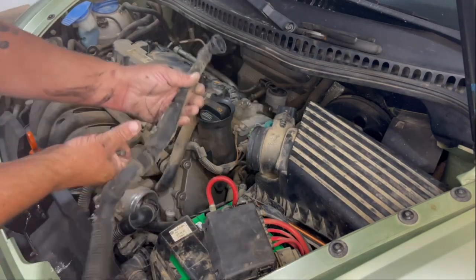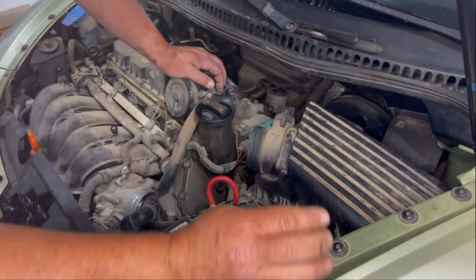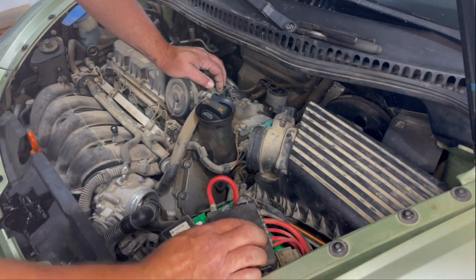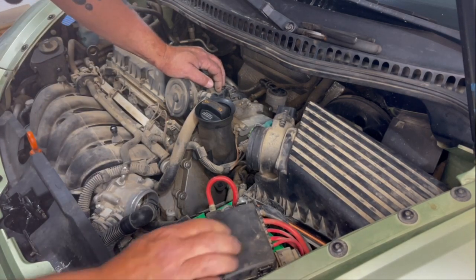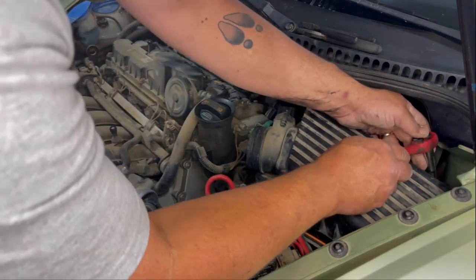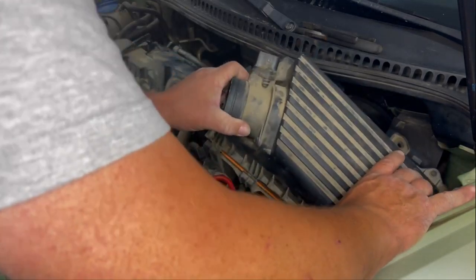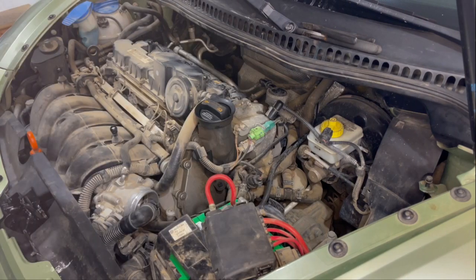The air tube is out of the way. Next, both the air box and the battery have to come out. The battery box on this one is quite tricky because it's stuck back in there with some extra stuff on top. I'll take the air box off first — it looks like just a 10-millimeter bolt to take this bolt out, and the entire air box assembly comes out.